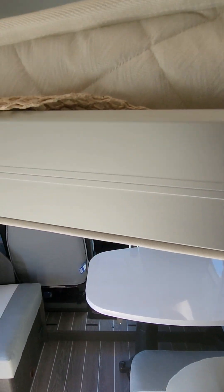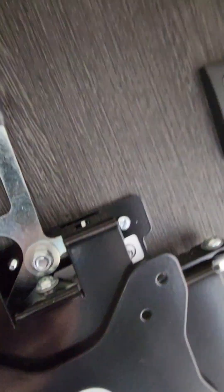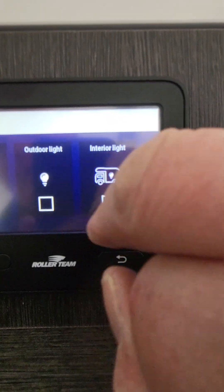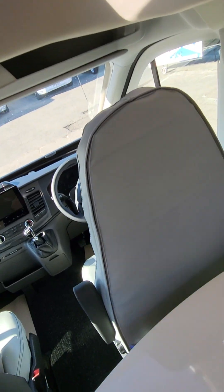If you're not going to use the bed for any length of time — say a few weeks — always leave a hand width at the top to let the bed circulate and prevent condensation. The control panel is here, your TV bracket is here with power sources for 12 volts and 240 volts. Unlock the screen and this operates your switches for your lights and water pump — your awning light or outdoor light, and lights inside. Underneath these cabinets it's touch control: touch the wee blue dot there to put your lights on across all your under panels.